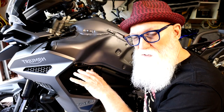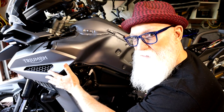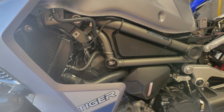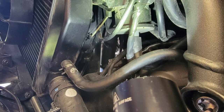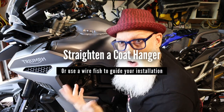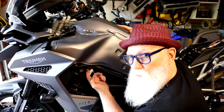Once you have that side panel off, that's really all you need to do in order to run your wiring up to the front of the bike. You have access to everything here — you don't really need to take this front panel off. Just be careful, it's kind of just hanging there and it is just plastic, so don't walk by and rip it off. You'll also notice when you get in here that you've got a radiator and all kinds of stuff in your way, so you're not going to have a clear shot to run your wiring. What you're going to have to do is get down in here, and you can see that there are a couple of clear paths that go towards the front of the bike. I got myself a wire fish — basically just used a coat hanger — and then I found a clear path and was able to run the wire. That's the wire for my GPS that runs behind the radiator and up through to the front of the bike.